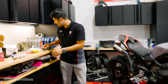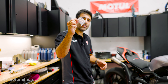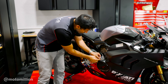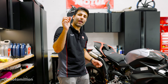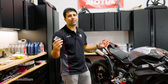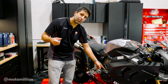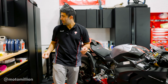The oil filler cap also comes with this little piece for track guys. You can take this bolt out and put this bracket right here, and it acts as a bracket where you can safety wire the oil filler cap. Some track organizations ask you to safety wire certain components of your bike, or they put a silicone goop on the oil filler cap to make sure it doesn't come off. This bracket is for the safety wire, if you wanted to know.